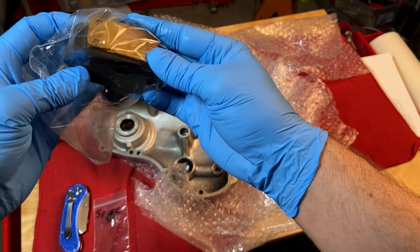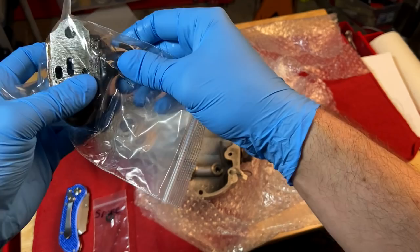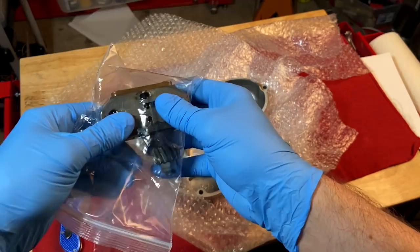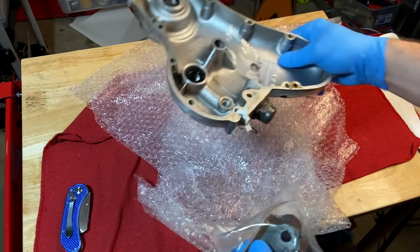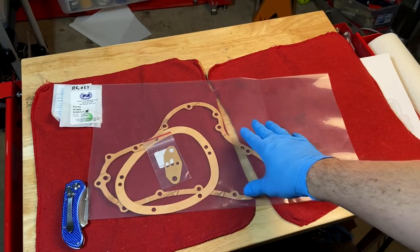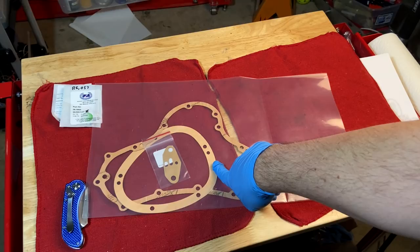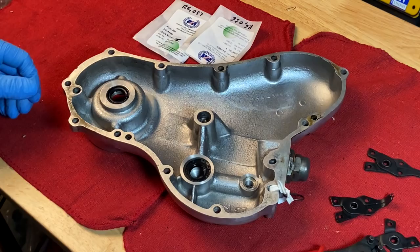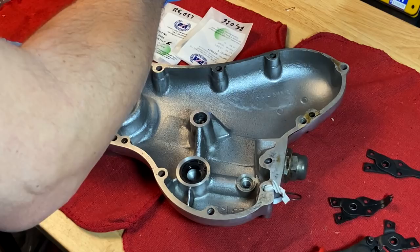The next part of the modification is the oil pump itself. Even though this has been repinned, I'm going to take this apart just to show everybody - what they do is they'll actually put seals next to the shafts here of the oil pump. We'll look at that in a little while. So that's the timing cover, that spare piece, and then gaskets - I've got the timing cover gasket, the oil pump gasket, and then the gearbox cover which I'm keeping as a spare. Since we've got the cover off and I don't know how old these seals are, I'm just going to go ahead and replace them anyway - they aren't horribly expensive.